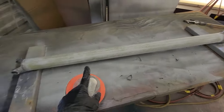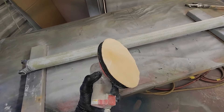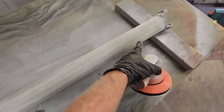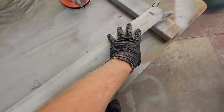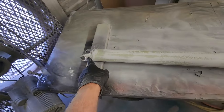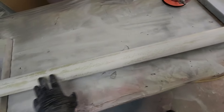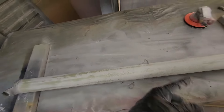We're all finished DA'ing the driveshaft. I used my orbital with a sponge pad and 320 on a Velcro back, just went back and forth and took all the primer that I needed out of this in order for it to go back down to the epoxy. The reason I do that is I don't need all this material on there — the only thing I'm trying to do is fill whatever I couldn't get so it looks nice and smooth when I base coat clear coat this. Now I'm at the point where we'll base coat clear coat it. We're going to do the ends in a different color — just a tad shade difference — using a flat silver. And then we're going to put our stripes in on the driveshaft and then get ready for assembly.